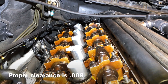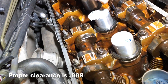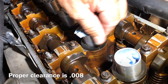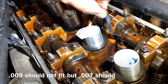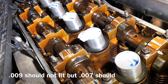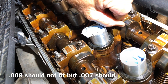I'm going to show you a pass/fail, go/no-go system. I take the feeler gauge — which is seven thousandths — start at the cam and walk it right down into the area we're trying to measure. That's a pass, which is good. The fail or no-go is the nine thousandths feeler — it goes down but won't fit. That little wiggling is all you should have to do. That is the no-go, so that cam spacer is correct for the setting we want. We're looking for eight thousandths, and the eight thousandths works real nice following the cam right inside.